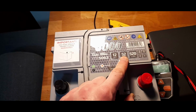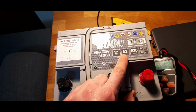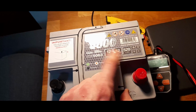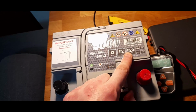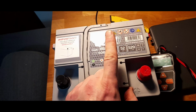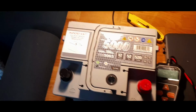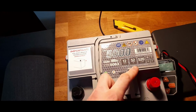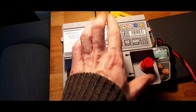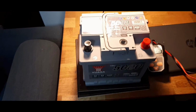But basically, that had about 30, I think it was about 40 amp hours, 38 or 42, and 380 CCA. I mean, that's just nowhere near as much. The specification for Rover 45s is 45 amp hours across the range, for about 45, 46, according to the handbook. So this is a really good size battery for the car, and powerful enough.